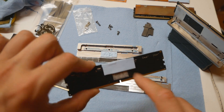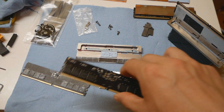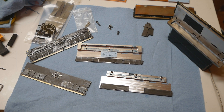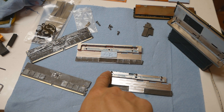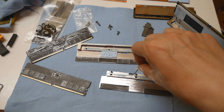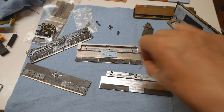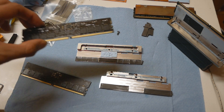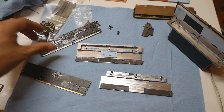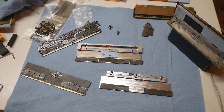On the back side, I used a 0.5mm plus a 1.5mm Arctic blue thermal pad combination. With this setup, I had good overall mounting pressure, perfect temperature results, and the memory stick perfectly aligned between the cooling plates. The only mistake was putting the in-between screws the wrong way around, but you can use an Allen key for fine-tuned pressure control. For insulation, I recommend using Vaseline all over the memory stick and cleaning just the top of the chips before installing the heatsink.